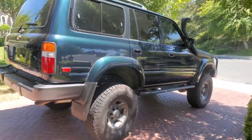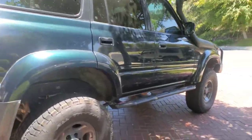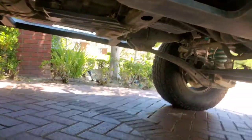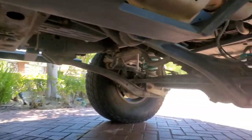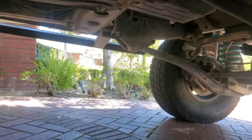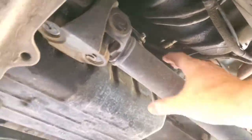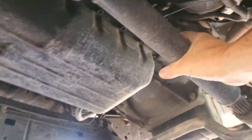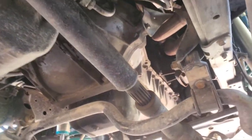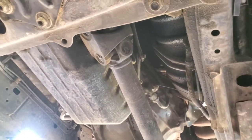This video is purely just to go over the drive shaft. Let's get underneath. What happens is you change the angle drastically, so even if you're going to change your control arms and the angle — caster correction — you are still going to get a drive shaft that could be making noise. Look at this drive shaft here — it's a double cardan but it is vibrating.